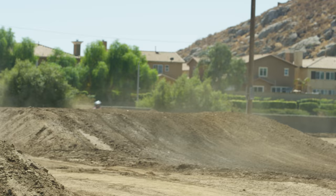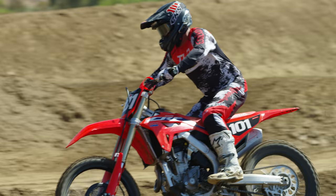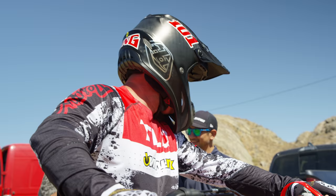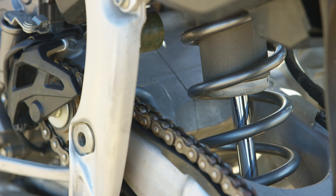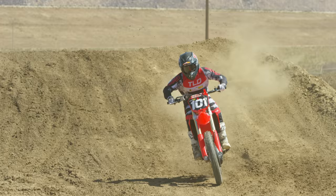The Showa tech wanted us to stress that Showa suspension is very, very sensitive compared to KYB. Where on a KYB you might go two or three clicks, just go one with Showa — it's super sensitive to change. That one millimeter fork drop made a huge difference. Looking at the fork, there are two lines; we just got the bottom line to where it was buried in the clamp — a very small amount of movement that made a very profound change in feel. After that, we went one click softer on fork compression and an eighth of a turn open on rear high-speed compression. Very small changes make very big impacts on this bike.